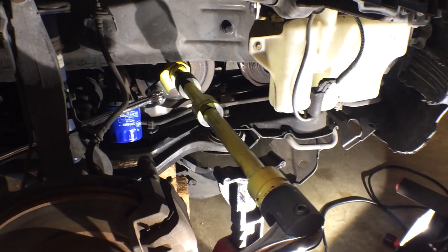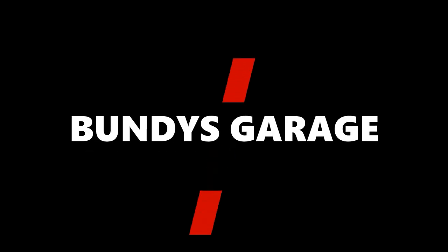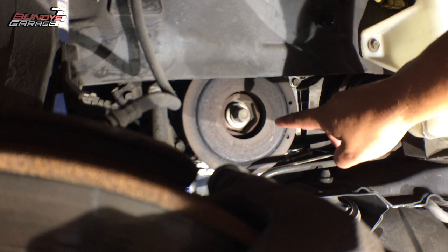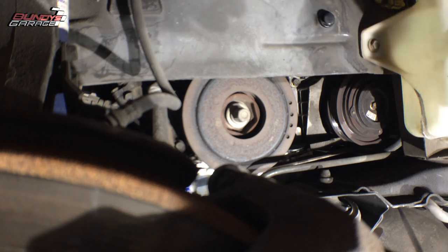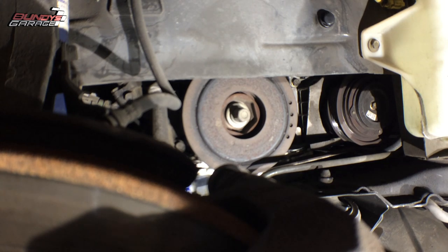These bolts can be a real mother sucker, so just be prepared to go to war when you're doing these. J-series Honda V6 crankshaft pulley bolt — right there. I'm always hesitant about filming these because I don't know if they're gonna come off right away and I look like an idiot, or sometimes they don't come off and you've got to use heat and a half-inch or three-quarter-inch breaker bar. Sometimes they're a hassle, sometimes they come off really easy. Whenever I see guys taking these off on YouTube, for some reason they always come off really easily — maybe they break them loose and rerecord to make it look easy. But I know some of you watching are having difficulties with this right now, so we're gonna tackle this together.